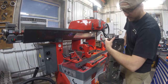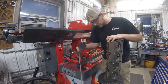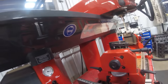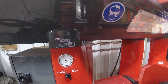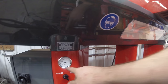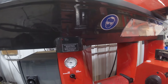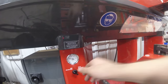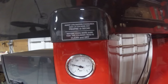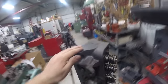Let's check the intake - perfect. Just for fun to show you guys, when I put this on there, there's how quick the gauge comes up. If it was leaking it would take the gauge a little while to get to max. For a perfect valve it pulls about 7.8 and I know the valve is cut perfectly. When I turn it down, there's almost nothing leaking out of that valve and that's how they all are.